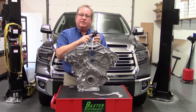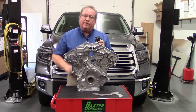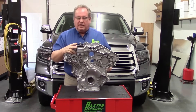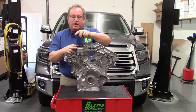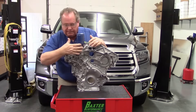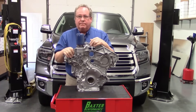Baxter Performance has introduced a cartridge to spin-on oil filter adapter that allows you to take advantage of the anti-drain back valve found in most spin-on oil filters. It also has an outflow check valve that opens on the inside of the adapter to keep oil retained in the filter from the outflow side. Once our adapter is installed you simply spin on your spin-on oil filter, keeping the entire system — from the filter all the way back through the oil cooler down to the pump — filled, so it doesn't have to make up for that lost volume every time you start your engine.